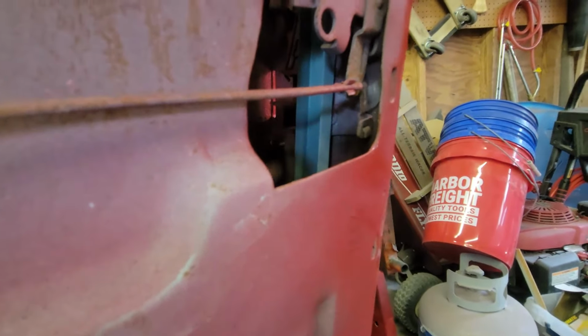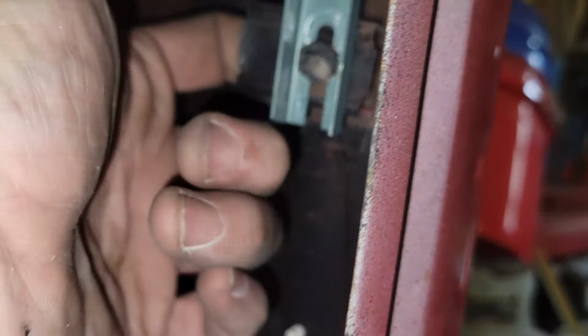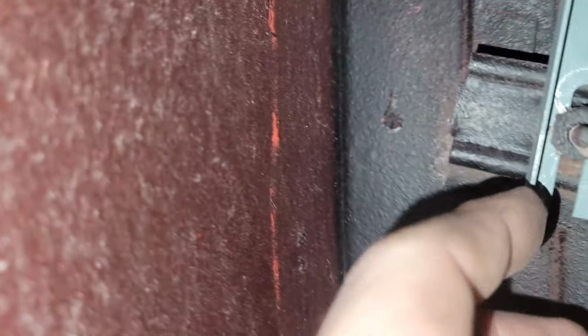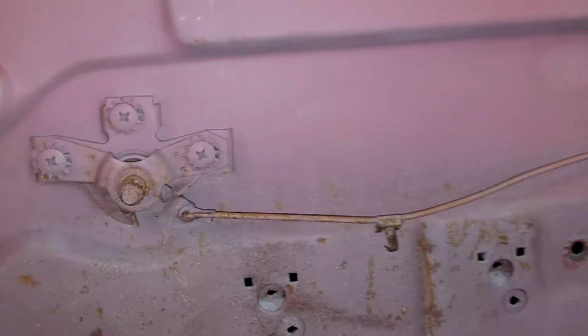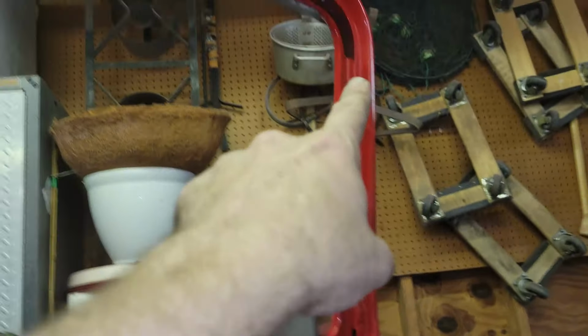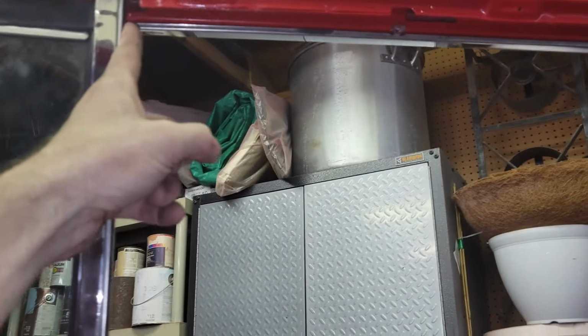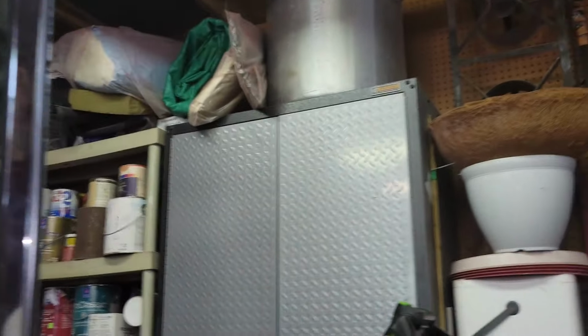It's in the door. I had to replace this one. This one was rusted. There's a little screw back here, and that's kind of a carriage head sort of a setup, and it's in a track. So this can slide in and out. Same thing with the track of the vent glass, that run channel. You can't even see it. So we need to put the run channel in that track all the way up and around and then terminate it here. So down here it can run long, but in here it needs to be exact. And that's all we need to do.